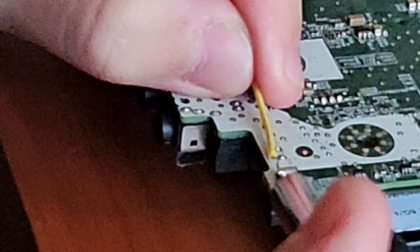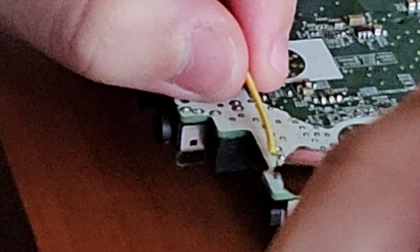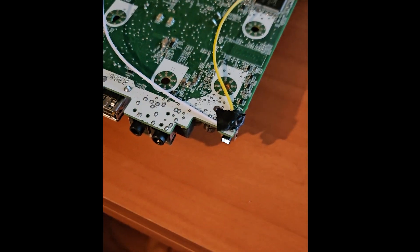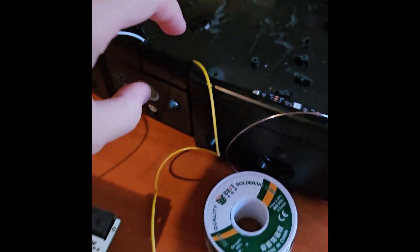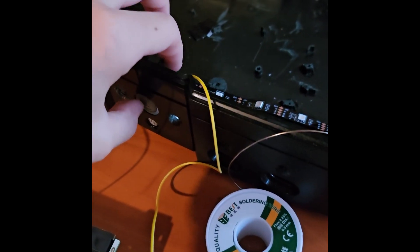I just had to solder the yellow wire onto the second pin of the power switch and the white wire onto one of the ground pins — I chose the left pin. There is a slight issue though: in this video I soldered the pins wrong, so I'm gonna show it in Paint instead of redoing it. As you can see, the points look kind of burned and messed up from multiple tries. But I was very fortunate I didn't break any traces on the motherboard. And now, as you can see in this short sequence, the mini PC is finally turning on from the Xbox's power button — which is very, very good.